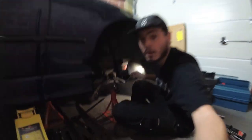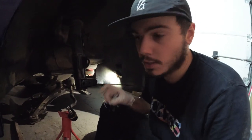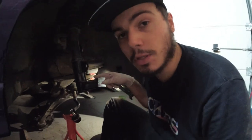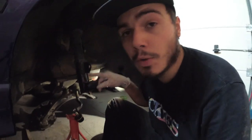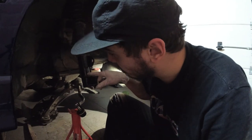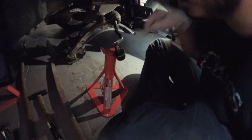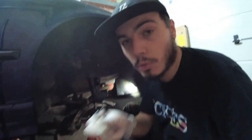Whenever you're removing a ball joint, make sure you have a look at the ball joint itself. Since it is loose there's no pressure on it, and when I'm loosening the nut — it's a locking nut — the ball joint spins with it. So I'm going to use pliers to grip the ball joint. There's also a possibility — you can put an allen key in there as well usually. Since I'm not reusing the lower control arm anyway, it's less of a concern.